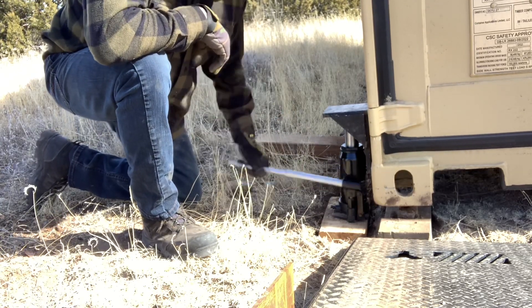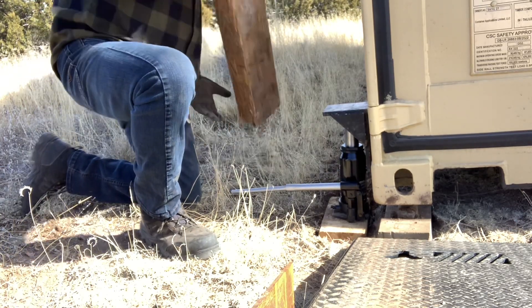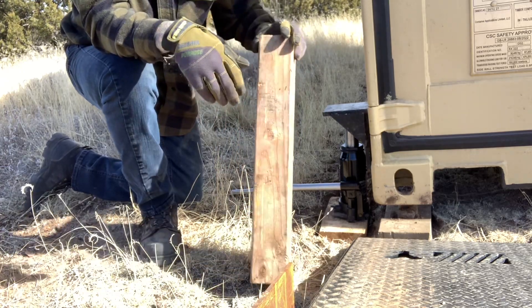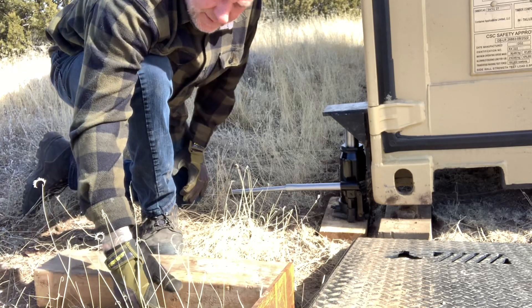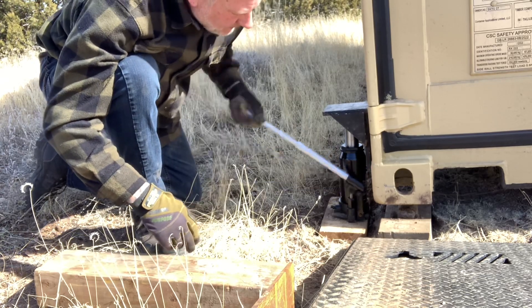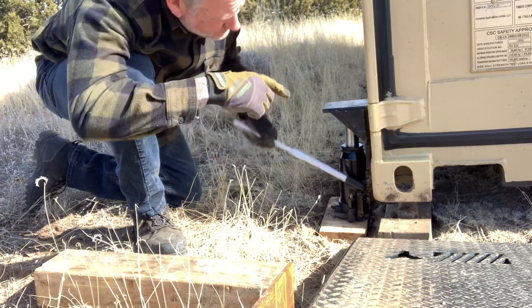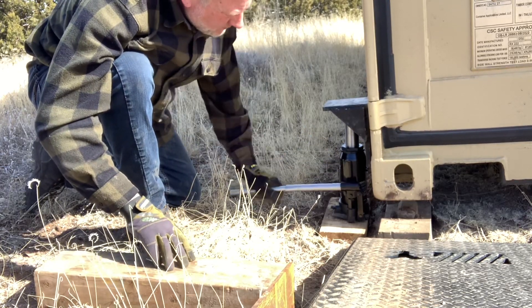This is a basic two-by-six. I have a bunch of them cut down inside my truck at all times just in case. These big chunks I use for stabilizing my trailer. I also use them for a flat tire — I had two flats the other day. Drive up on two of these, one acts as a ramp, and you can change your flat tire if you have dual rear axles or dualies. So anyway, we're going to try and shove this underneath there. I already have more on the other side — it's balancing out. I'll show an overview when we're done.